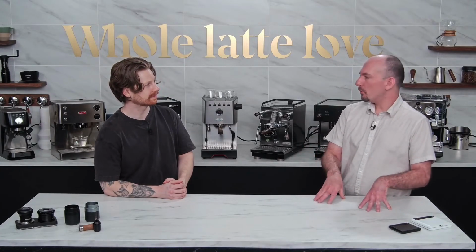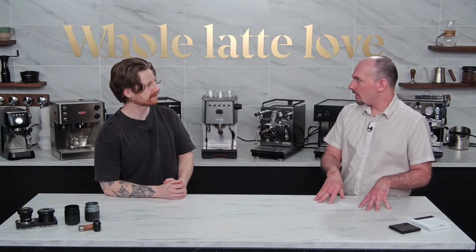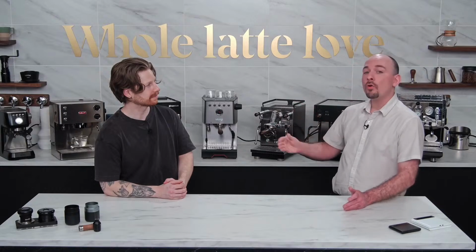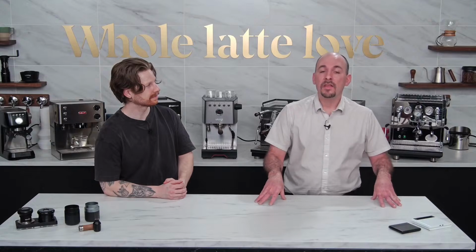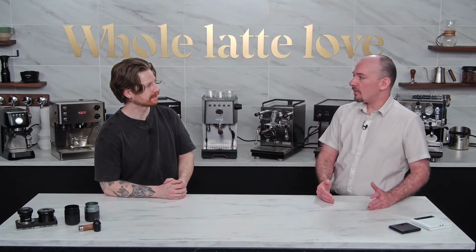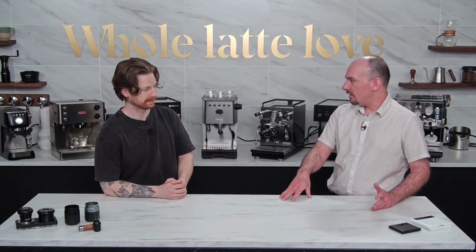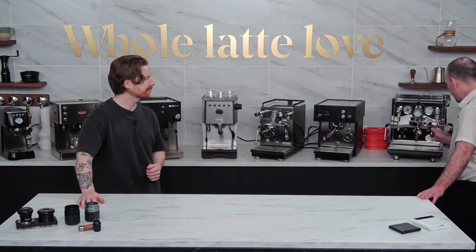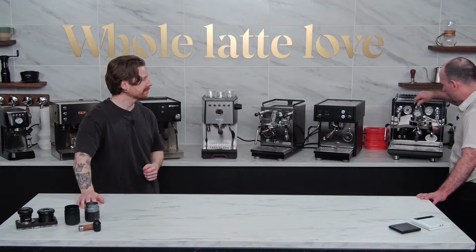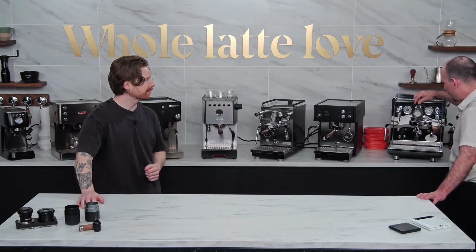So once upon a time, before we started putting flow controls on things, or putting proportional valves inside machines to control the flow rate, or having externally adjustable OPVs, what you could do is plumb your machine into a water line and then use the much lower water line pressure to pre-infuse your coffee. Let me just get this to stock for a moment. So we're going to do 1 1/4.